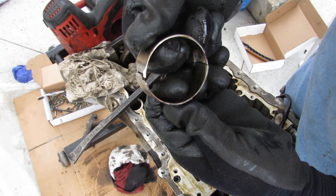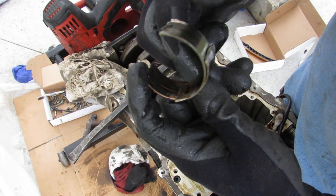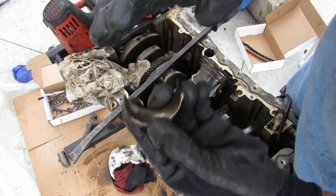Eventually these connecting rod bearings are just going to seize up due to all the heat and rotate in this direction. That's what causes rod knock, because you no longer have a bearing at the top as the piston moves up and down.